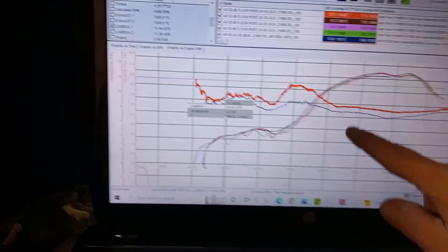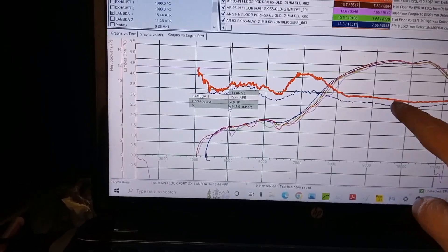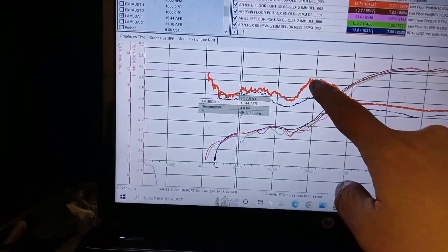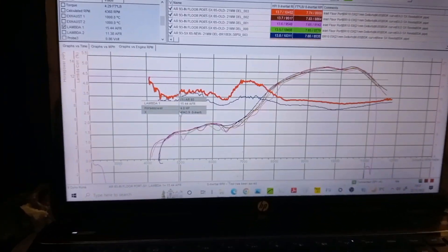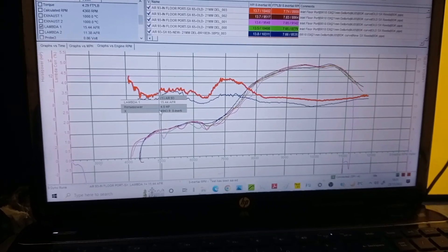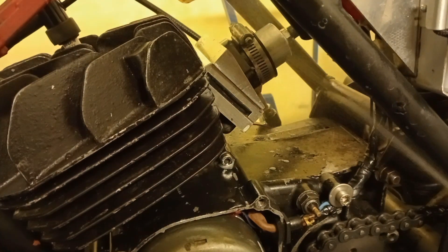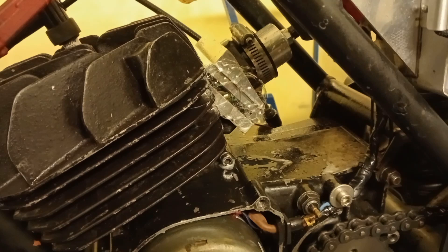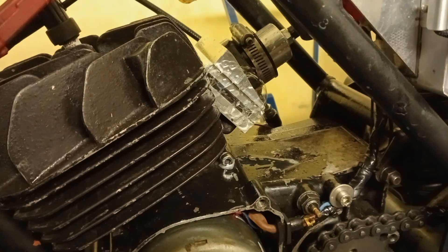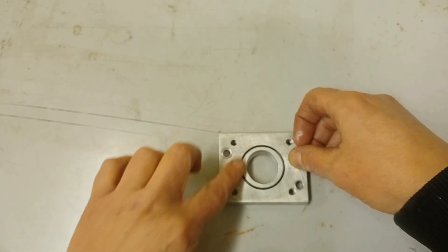That's about 12 and a half... no, that's 13 actually. This one it's gone up to 14 and a half, and up here it's at 17 lambda. So that is my issue — I've got another leak so I'm going to have to sort that out first. I thought I'd do a quick leak check before running it, pleased I did. It's leaking from this interface again, so I'm going to replace the O-ring in there. However, it doesn't appear to be leaking from the reeds, which is good.